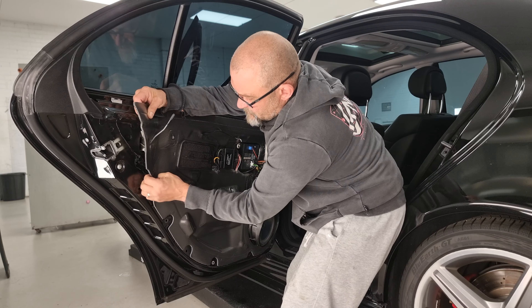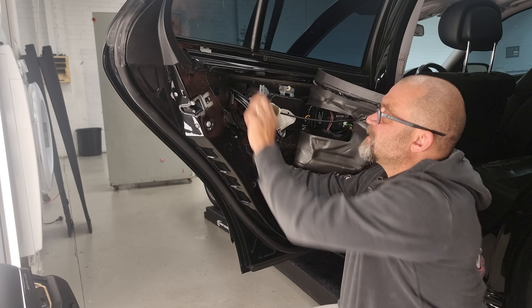So I'm going to bring the camera in a bit closer and show you what we're going to do. That's the actual plug for the electronic door release, where you can press a button from the outside. What you want to do - that's on like a seesaw, like a swivel - you want to push that in on the right-hand side. So you push that in and you'll feel it move, push it in on the right-hand side so that it ends up on an angle. Once you've released that, then you've got a line of sight to be able to press that little switch in, and then you can do it from here - you don't need to remove all that.